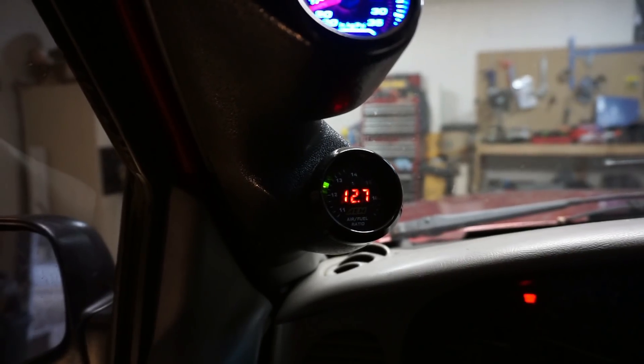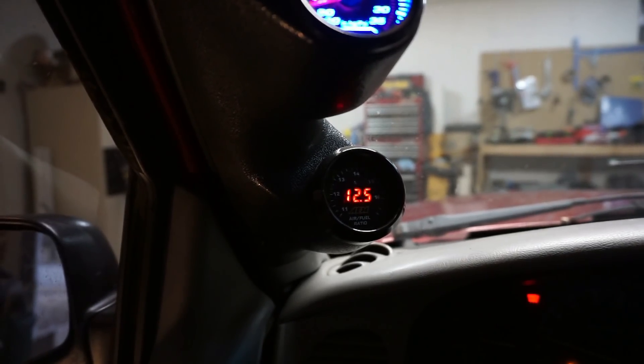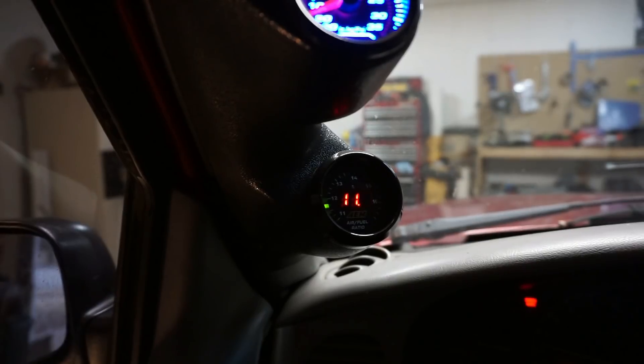That's a little bit better than yesterday. I'm going to let this thing warm up and drive around to get it to operating temperature, then look at where it ends up and start making changes. But I put it in gear, gave it a little throttle, and it went to like a 9-10 air-fuel and died — so I can't even get it out of the garage right now.